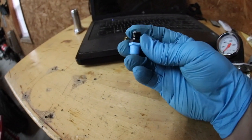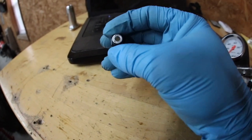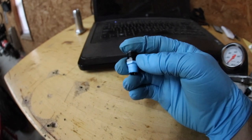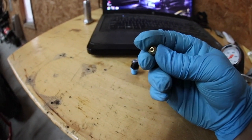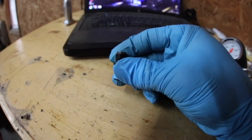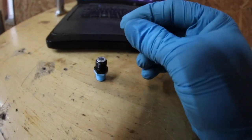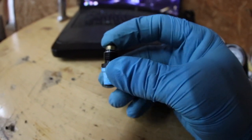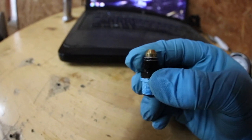Okay, here is the finished version. I cut this thing down, cut the flare off the top, added some thread tape to it, drilled out the center, and then cleaned off those edges. If you do drill this out, a drill press would be great — I literally just free-handed it and you can tell. But the fitting looks pretty straight and we'll see what happens. Anyway, here's my jet. This is at a 65-thou hole right now, and I've got the next size drill bit ready in case I need to go bigger. It's shorter because you can see where the flare was cut off. When you slide this inside it, I got lucky and found a bit that was just the right tolerance so it actually fits almost tight. I threaded the line on there and it actually seems to seal up pretty good — we won't know until we tighten it down.